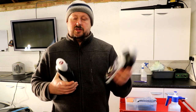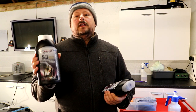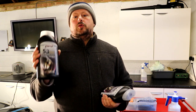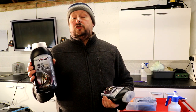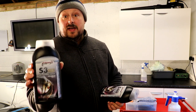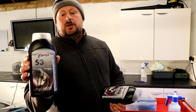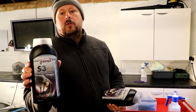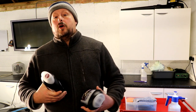It's a really oily, heavily lubricated product that will not dust on you. I find it's great for using on rotaries. You can use it on dual action. I just find this is a great all round compound, especially for someone starting out, because you can overwork the compound without too many implications. You can't say that about every single compound out there.